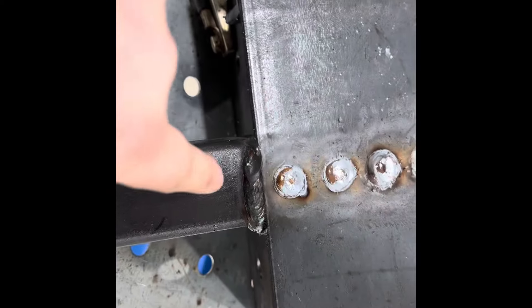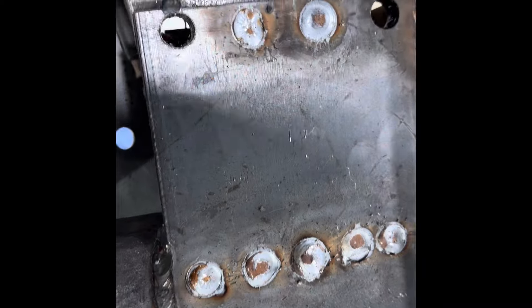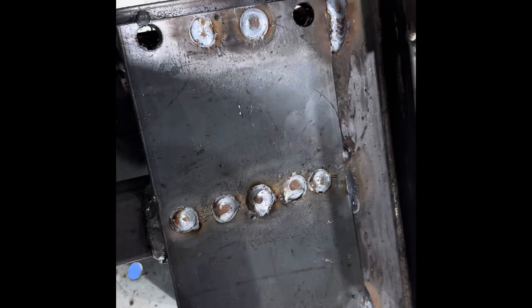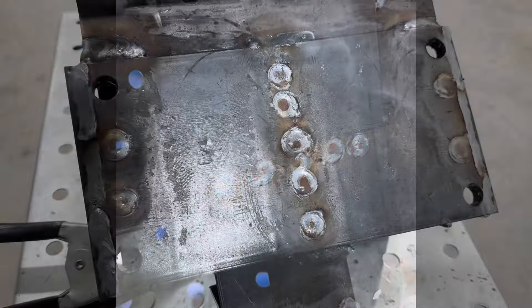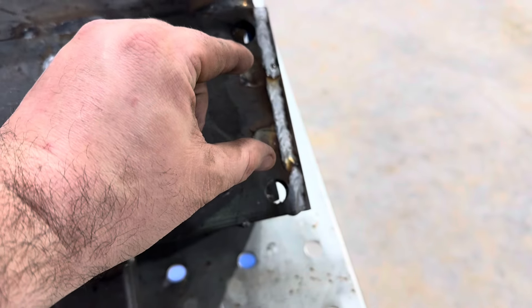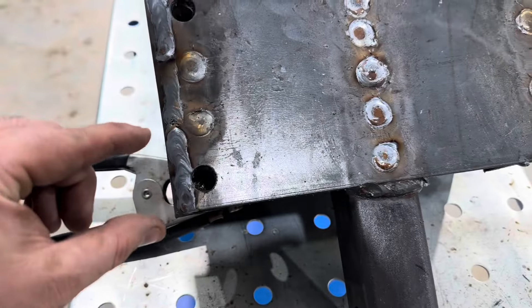We've got the tube pretty securely fastened here, and these plug welds are helping hold this angle bracket down here. We have our holes for our winch footprint right there, so hopefully our winch mounting will transfer to everything in a very nice way. I'm going to weld these really quick, then turn to welding the verticals for the little tabs for the winch fairlead. I welded there and there first, then there and there, then there and there — moving the heat around.